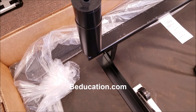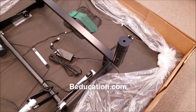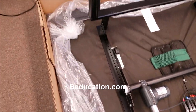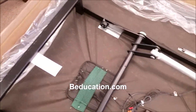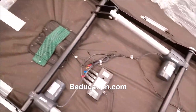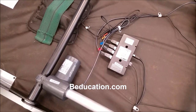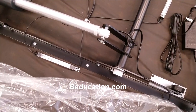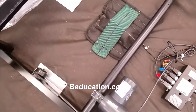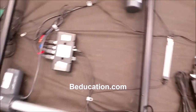Then we'll take a look at everything on the undercarriage of this unit. Now that I have all four legs installed at all four corners, and I've made sure the height is adjusted to a similar height for each leg, it's a good time to take stock of the bottom of the power foundation just to make sure that everything is in place and nothing was damaged during shipment. Take a look at the head-to-toe side rails and the rotating arms to which the motors are attached. Make sure all the wires are connected to your brain right here — there are four wires attached to the two motors. Here's the motor that drives the foot section, and this motor drives the head section up and down. This is the massage unit for the head, attached with a wire to the brain, and here's the massage unit for the foot section, also attached with a wire to the brain.